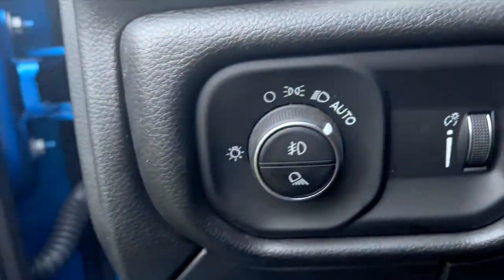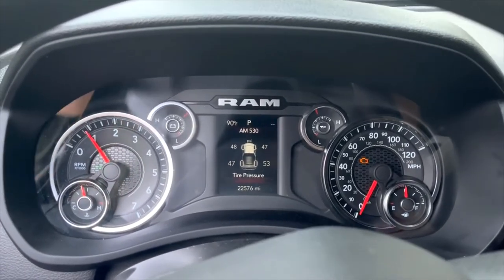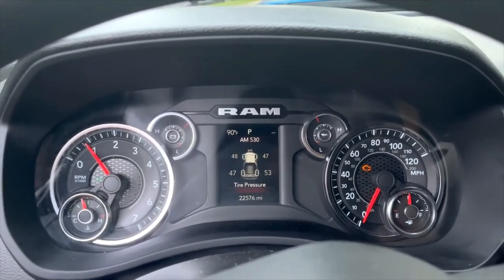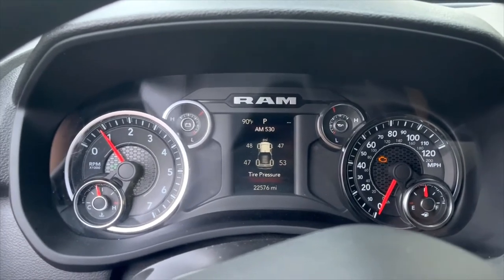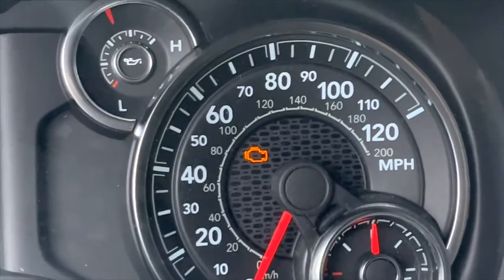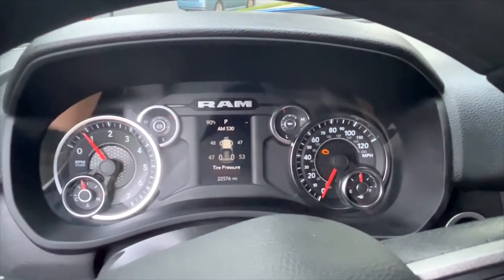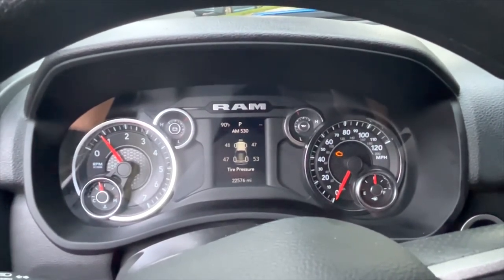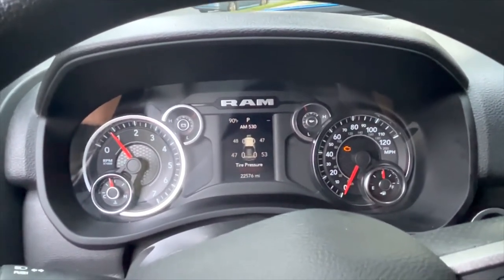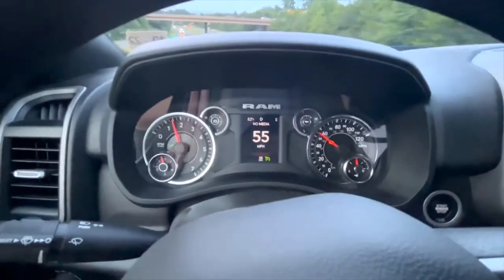After programming and a lot of back and forthing, I dropped the air pressure down and so far there are no low pressure lights. You can see I've got to drop the rear down a little bit more — I picked around 45 pounds. I actually set with the ProCal a 35 PSI cutoff, which is as low as you can go. There does seem to be a feature where if you goof up something with the install, a warning light hangs around. I'm going to take this for a drive and then check how the GPS compares with the speedometer for the tire size.